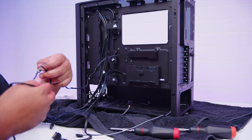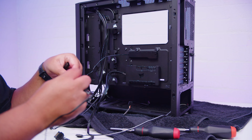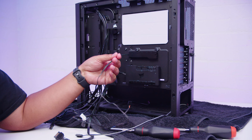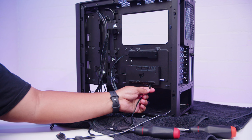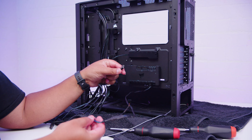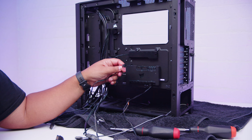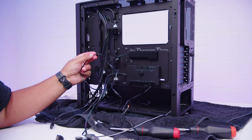On the original build video, I often get asked how I connected all of the Lian Li Uni fans into a Commander Pro to do RGB, and if I would ever make a video talking about the adapter that I created. The answer is, I don't think it's interesting enough to make a whole video. Maybe I'll make a short on how to make it. Essentially, I cut up a Corsair cable, and I got a regular RGB cable, and I got the pinouts and the wiring for each cable. Basically, this end plugs into the Corsair controller. This end plugs into a normal 3-pin 5-volt addressable RGB connector. And then on the other end of that connector is another 3-pin connector with a clip on it that you'd typically find on the V1 Unifans. That then connects into a 6-way Deepcool hub that uses the same RGB controller. And that's how I did all the lighting in the case. And I used iCUE to do everything. So there's a very simple explanation for that.